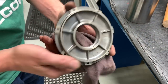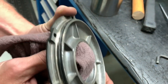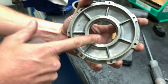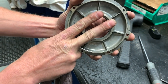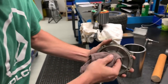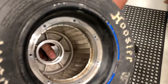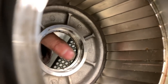The next thing is to look in here — notice there's a lot of dirt. This is what we were trying to clean out with the toothbrush so we didn't open it and dump dirt in there. Regardless, you want to make sure the bottom of the bearing seat has no debris and will allow the bearing to fully seat evenly. If there's anything under there, the bearing is going to sit cockeyed and won't pinch the rotor properly to the specifications that Future Motion designed. You can see the whole bearing seat — if we just shoved a new bearing in there now, there'd be crud underneath.